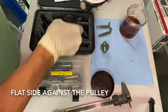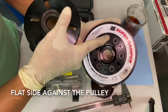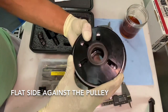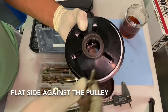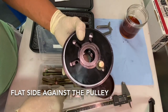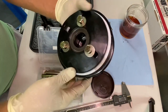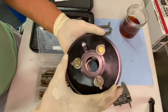This part number is 918476, and this is a street version of the super damper made by ATI for B-series. Take the base plate and put it on the damper, finding the three threaded openings. Line up the holes, then grab some 5/16 grade 8 hardware and put them in the holes hand tight. They don't have to be super tight — just keep them a little loose in case you need to adjust.